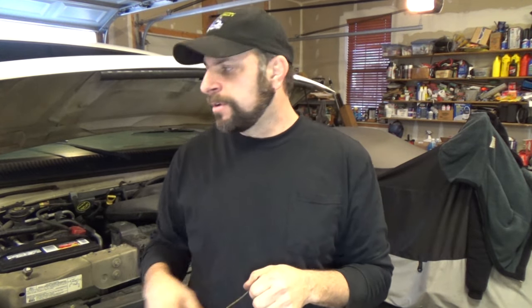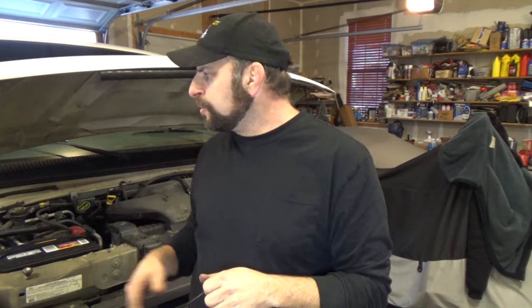So this little test here can help you out a lot, so go ahead and check that out. This van is going to need an ABS pump, and they're expensive. Even on a used older vehicle — new ones are probably around $800 to $1,000, I'm not sure. Used ones you've got to search online. There's a code or serial number — that sticker on top — and you need to match that up to make sure it's compatible with your vehicle. That's pretty important.